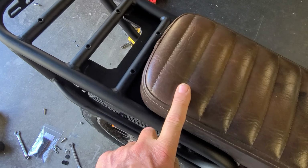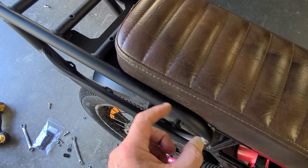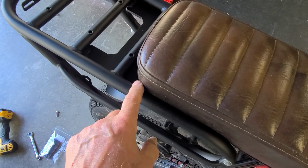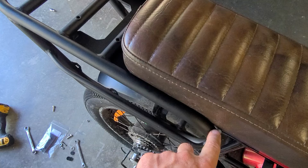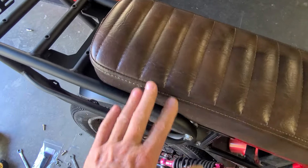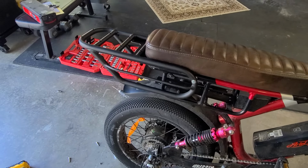So I had to take this vinyl off. I had to cut the vinyl, and then it's plywood underneath there, and I had to saw off about that much, 1/4 inch, almost a 1/2 inch in there to get this thing, cut it right here, and then I had to restaple the vinyl back underneath there and then sandwich it down. Okay, that's problem number one that I ran into.